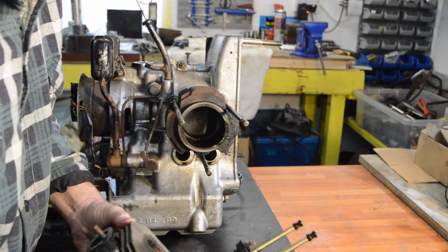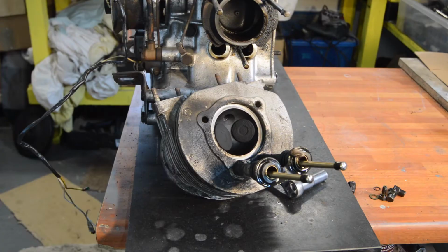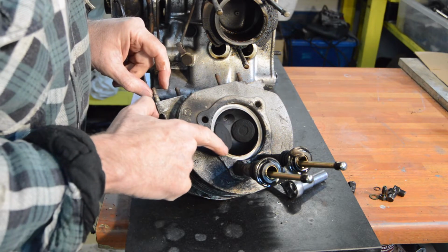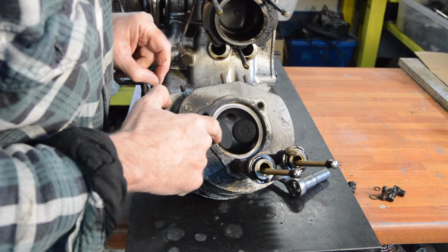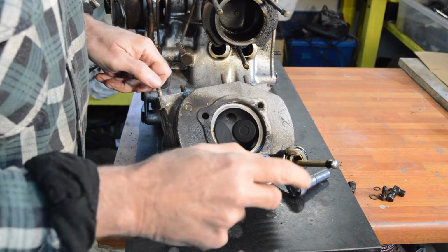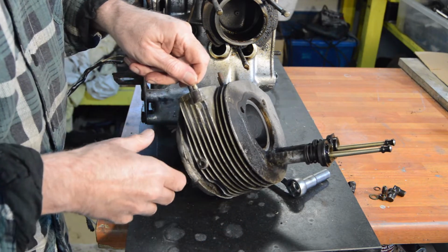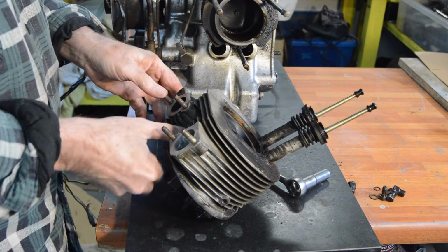So, initial thoughts. Right, where the barrel sits appears to be okay. It's nice and clean. The valves themselves are whole, and although it's black, it's even. Bottom of the push rods look good. Push rod tubes on this side are undamaged. Right, so we may have a workable head. We shall strip that shortly and have a look.